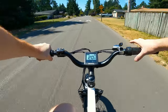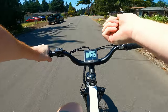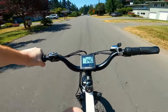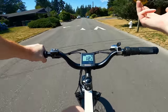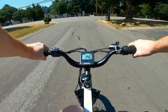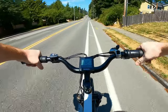Kicks in right away. So there are two types of e-bikes. I went to the Electrify Expo and talked to the Himiway group. They were telling me about cadence sensors and pressure sensors. The cadence sensor, which this bike has, means the motor kicks on to whatever speed mode you're set at as soon as you start spinning the pedals — so you have to be pedaling faster than the motor is pushing to get exercise. With a pressure sensor, the amps the controller puts out depends on how much pressure you're putting on the pedal — a little pressure gets a little motor.